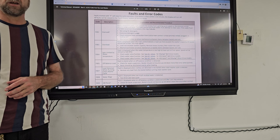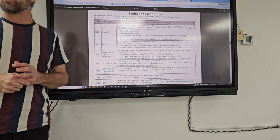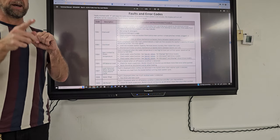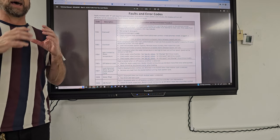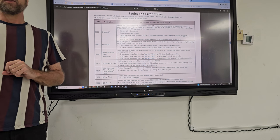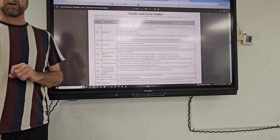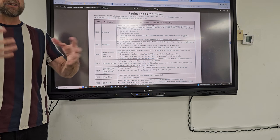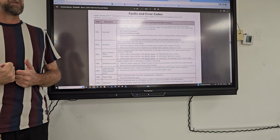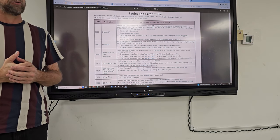These machines don't use as much water as the older machines. So you must use detergent that has the little letters HE on the box, which means high efficiency. That high efficiency detergent is a very low sudsing detergent. When you wash your car, you want nice soap suds, but we don't want all those suds in these machines because they don't fill up with as much water, so that excess soap would stay in the clothes. Okay?